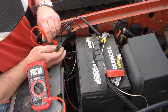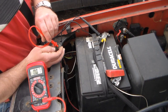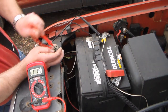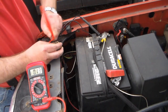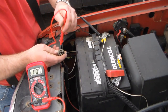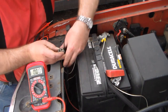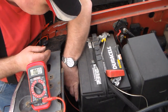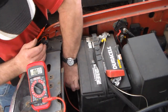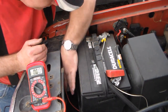There's 11.45 volts on low beam, and zero and zero on the others. So this red lead with the black tracer on it right there will be the hot for your low beam. I'm just going to go ahead and plug it back in — well, I don't know why I'm plugging it back in, I don't have to. I've got to remove the bulb and the headlight anyway.